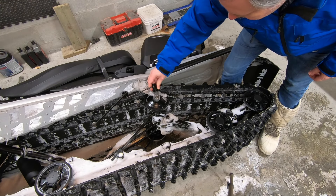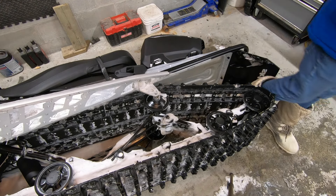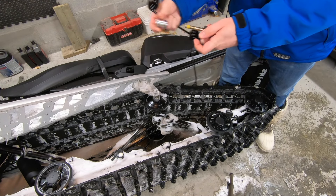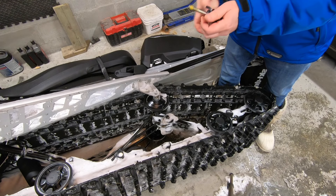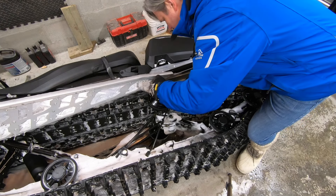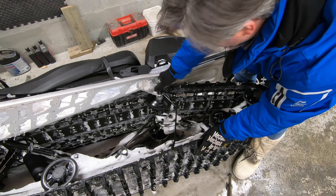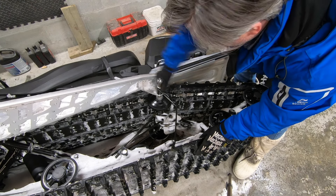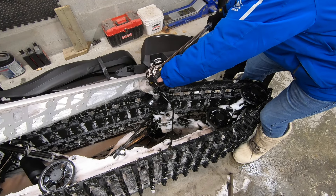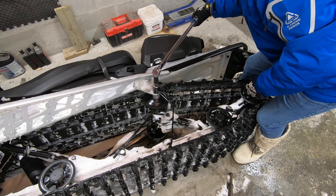Make sure to select the correct ice scratcher. Here I'm trying to position the right ice scratcher on the left side and it's clearly no good. We can see that the left ice scratcher is correctly oriented on the left side of the sled. Now I insert the bolt, washer, bushing, and sleeve assembly into the ice scratcher and fasten the whole ice scratcher assembly to the upper arm. I had to wrestle the suspension into position to align it with the hanger before inserting the new bolt. This upper arm retaining bolt is a critical part of the rear suspension, so take the time to correctly torque this bolt to the recommended 35 foot-pounds.